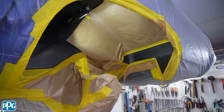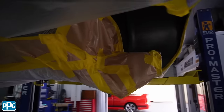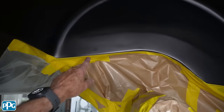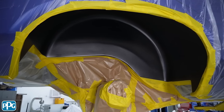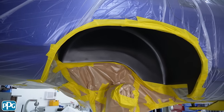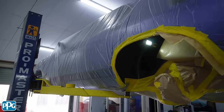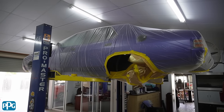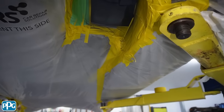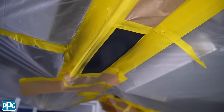There are a few pinholes and things I've fixed up so I'll get a nice even coat of color and then my satin clear, and I've got the other side to do as well but I'm really just doing that one to make sure it matches. You can probably see there a couple of rub-throughs that we had right from day one - that occurred between coats of clear and we didn't realize until after it was re-cleared and then we saw it, so it's always been there. I'm out here on my own on Saturday morning just going to get that primer on - this is a wet-on-wet quite thin primer with a slow thinner on it so that it'll lay down.